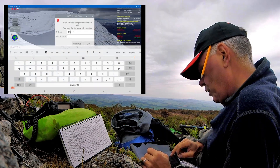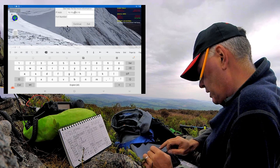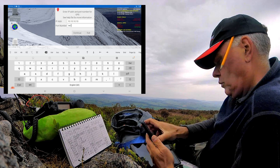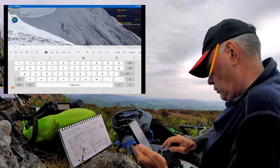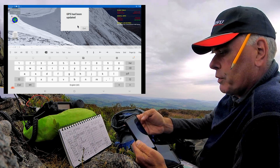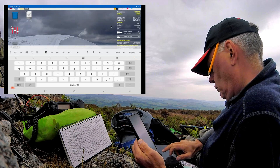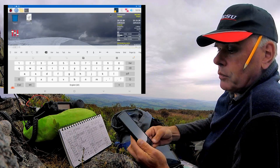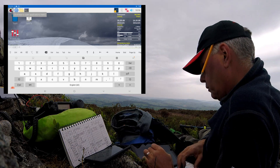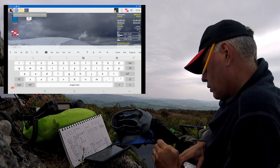In order to do that I use a little app called GPS Update Tool. The IP address is 10.10.10.10 and I use port 147. I start the app — it's got the same IP address 10.10.10.10 port 147. It's now streaming GPS data, and in a moment the time will update. We can now see the time is updated to 15:25, which is identical to my satellite-controlled watch, on the 15th of June 2021.